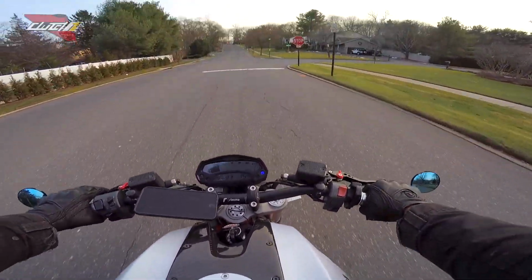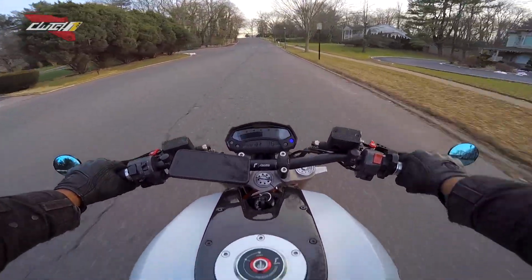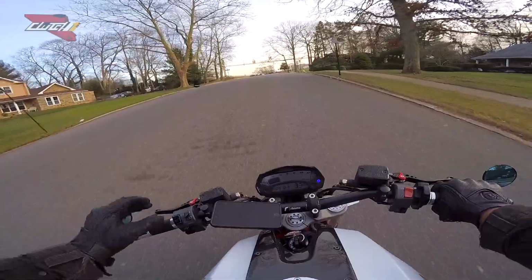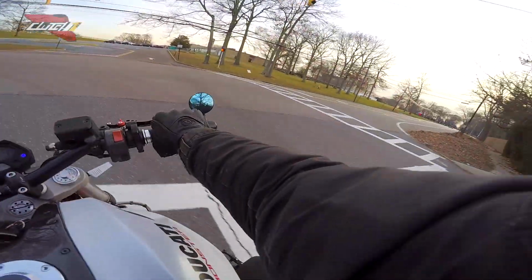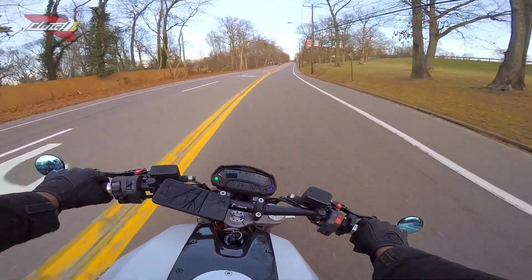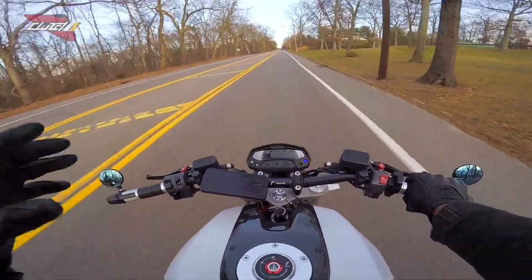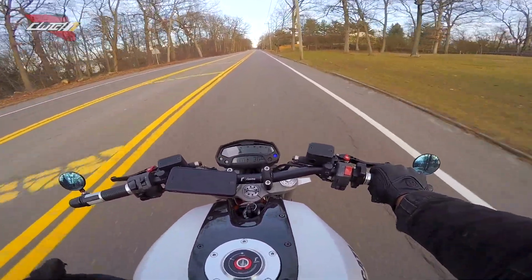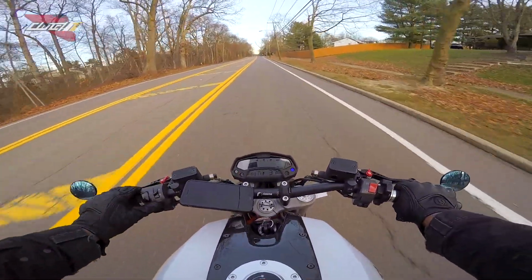There's a few ways of remedying these things. If you're interested in a Ducati, you want to have smoother gearing, where it's a lot easier on the rider. One option you can explore is to change your gearing. You can change your sprockets. The front sprocket, I think you can bring down to 14. I don't remember it specifically. I haven't done that on a Ducati in a while.